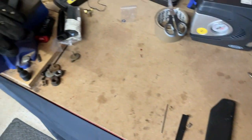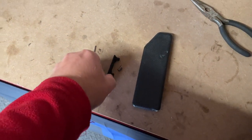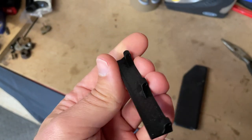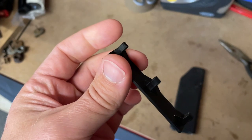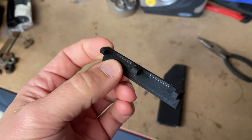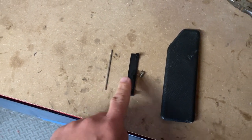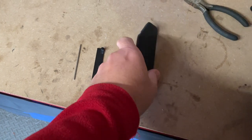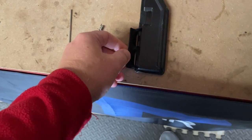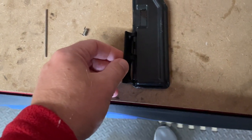The actual clips that join it on are all okay, and it's the ones on the car that are broken. So to replace the ones on the car, I bought this off eBay — I'll leave the link in the description. It's a replacement hinge that you glue onto the existing trim panel on the car, and I've got the original spring and the original rod that goes into this hinge and latches it on.